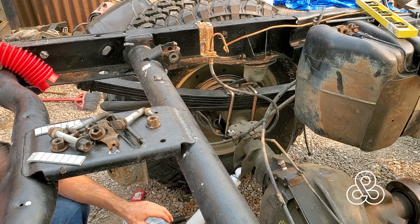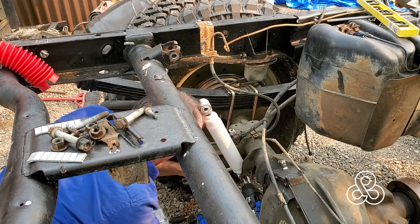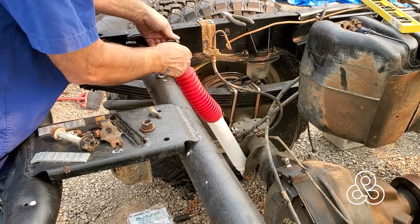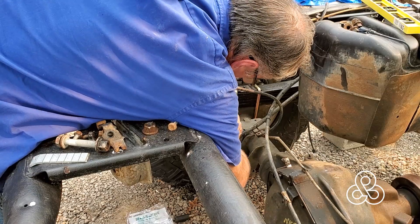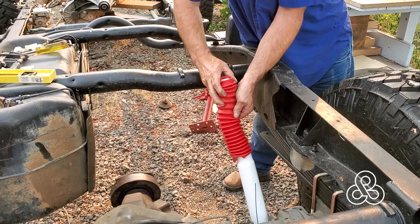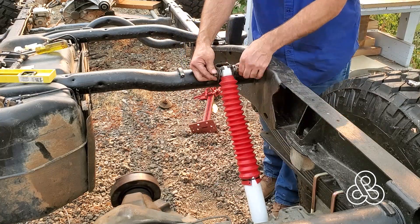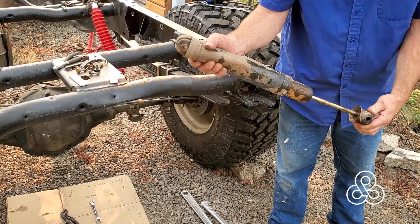Now we're replacing the shock absorbers as well — I've got some new shocks from Rancho. Get the bolts in place. You need three hands, so you might as well just use your head. Get it pointing right where it needs to go because once the retainer is back it's going to start to expand. Push it back until you get some bolts in it, stretch those into place, and use a little zip tie to hold it around the body of the shock. Same thing on the other side — you're fighting the shock trying to expand on you while getting the boot on. Once you get that bolt in, you're home free. Boot on, zip tie. Here's the old shock — floppy and loose. Going to be a new ride after this.